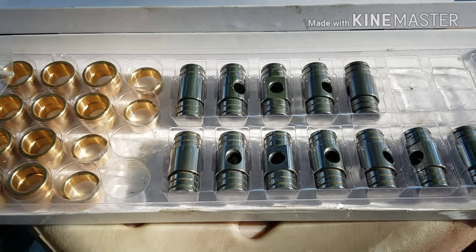Just wanted to give y'all a little update — got a few un-pressed in. It's probably not too much of a how-to video, just a good informational video on the trunnion upgrade for the LSA. Alright, so we got one pressed in, went pretty nicely. Just got to find my snap ring tool — might have to go buy another one. All you need is a 7/8 socket, put it down on it, then come with a 5/8 socket and it'll fit over it. First you press one side bearing in, then you slide the shaft in, then you put the washer over it, press down on it, and voila.